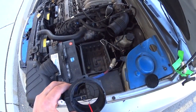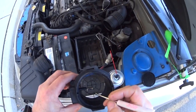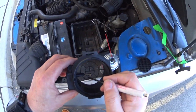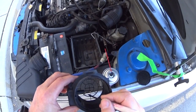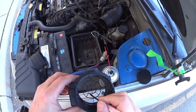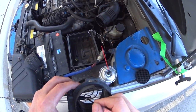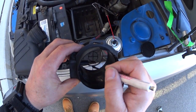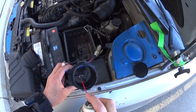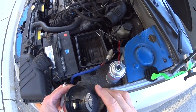Right now my numbers are good, but I want to get better numbers. What I'm doing — I already cleaned it a little bit — I'm just touching this element here gently, not making any pressure, and the same one on the back, not making any pressure, just cleaning it a little bit and spraying the solvent on it. Most of the time — let's say 90 out of 100 — when you clean these guys very clean, it does the trick and will fix the problem.